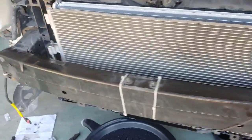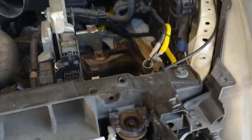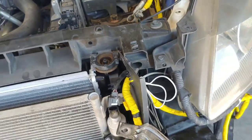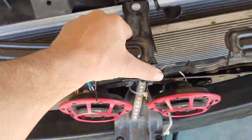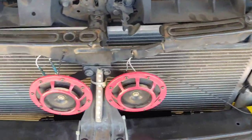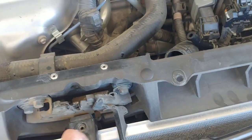The front bumper comes off — plastic bumper off. There's a bolt up in here, a couple of screws down here, same thing over on the other side, and then you've got a couple of those little push tabs. Once the bumper's off, next thing you'll do is take this little frame piece off — just two bolts here, a couple more plastic push pins, and a bolt right there. I took that off; I've got stuff wired to it so I just let it hang.